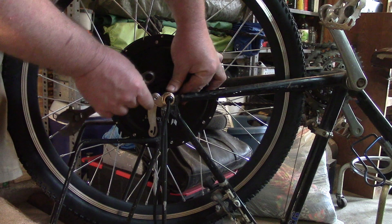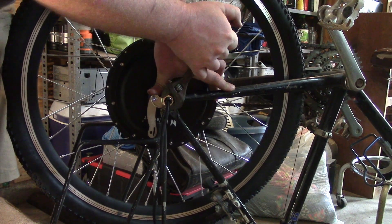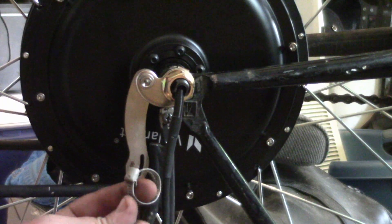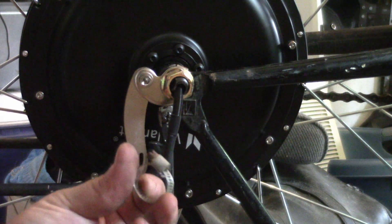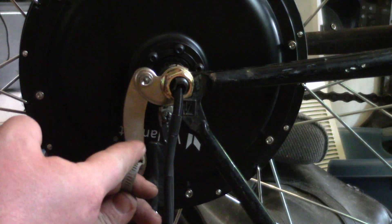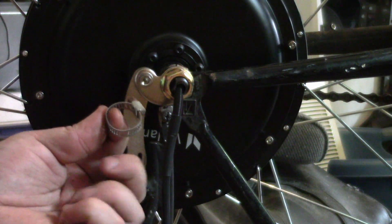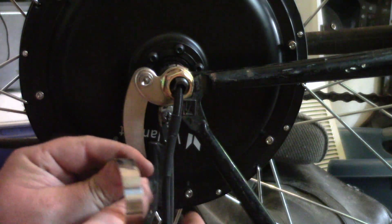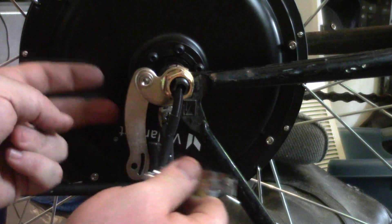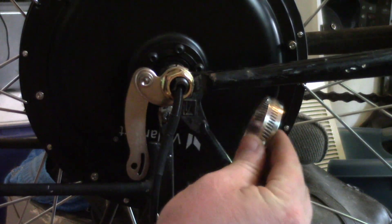I'm holding this back because there's a little play in it — if I hold it in position while I tighten, I might get maximum use out of this torque arm. I'll use hose clamps because imagine getting a flat and having this mounted without common tools like a flathead or Phillips. I'll use a smaller hose clamp, but this one is threaded all the way down to the base and won't get small enough to wrap around this little bar. This bracket is meant to straddle it like that.